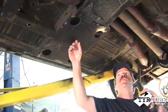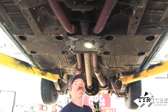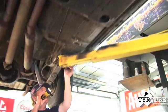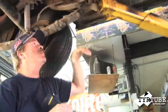There's a convertible floor pan — a lower floor pan for a convertible. They put those on there and then added this plate that ties the two together. This plate is bolted on just to stiffen up the convertible chassis because it doesn't have a roof. Same way with the inner rockers — there's a tube inner rocker that runs from the very back of the car all the way up to the front, and your floor pans and everything tie to that.